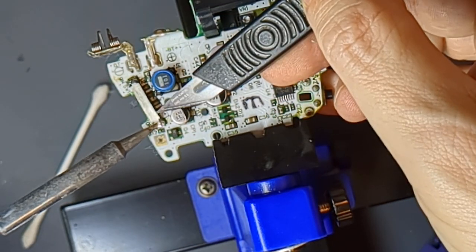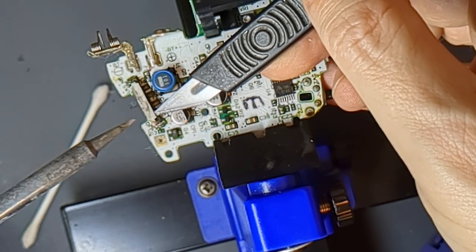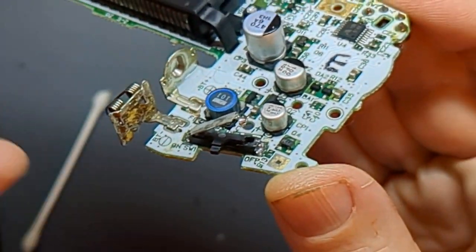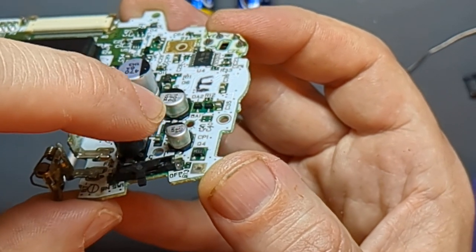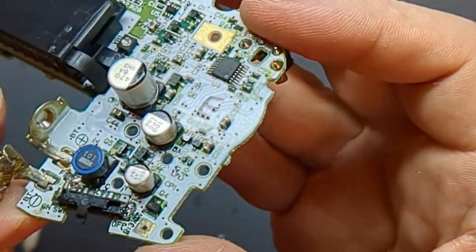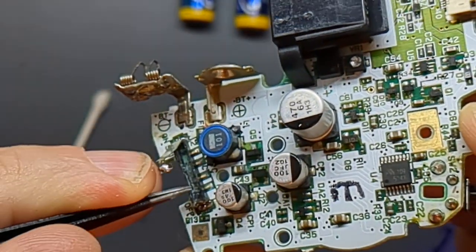That's starting to move. There we go, at last - it took a little while to lift off. We've managed to get that off. Now even if I can't get the other side off, it means I will be able to get in and inspect the switch. Looking at the switch where I've heated this point and it lifts off, I can now get to the inside of the switch. I'll bend that part back a bit and then bend it slightly in the middle because it raised itself when I was trying to lift it earlier. Now that I've got the switch exposed, I can lift out this part and inspect the inside - as expected, it is very, very corroded in there. That's going to take quite a bit of cleaning.